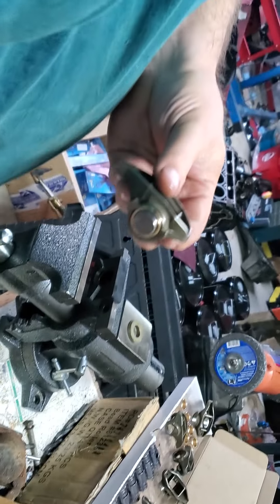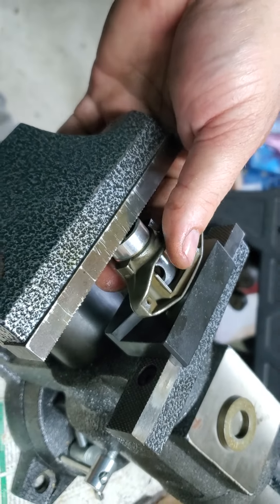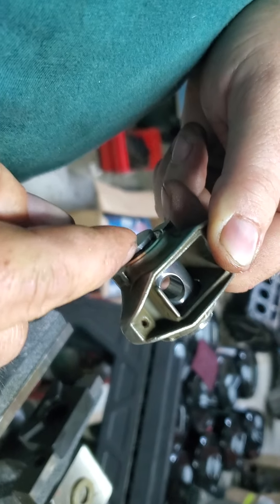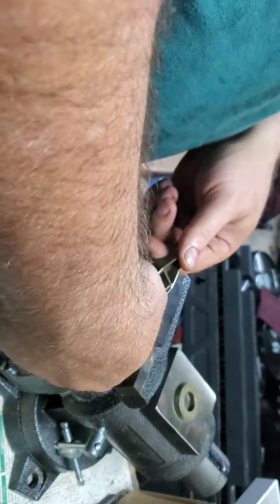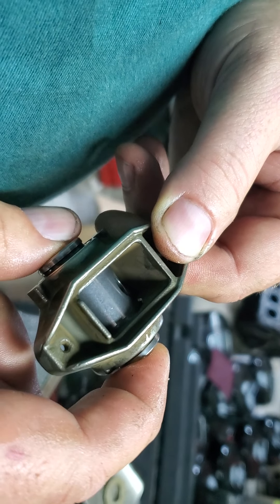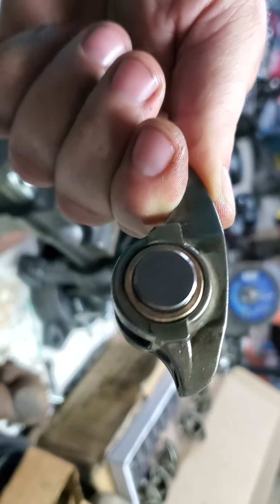If it's not tight enough or if you think it should be just a hair more, take your little spacer and give it just a little pull — that will tighten it up a little more. You can see the side-to-side play is less now. If you want it a little more, you can press it further. That's perfect — very little side-to-side, it's got play, it's got assembly lube, it's nice and smooth, not tight. Do that 15 or 16 more times and enjoy the bronze bushings.